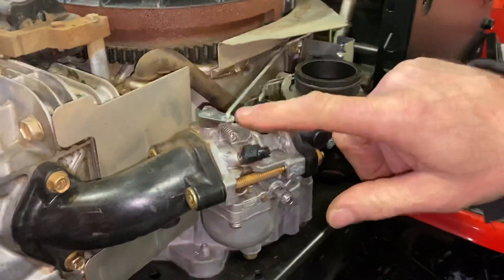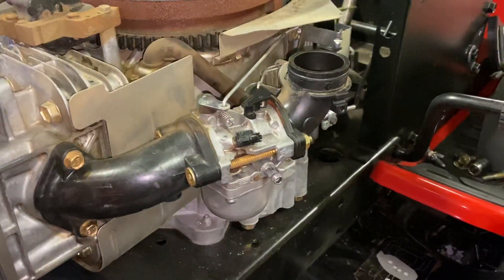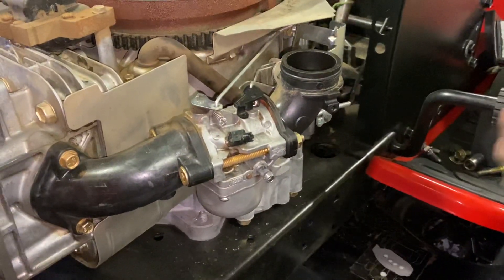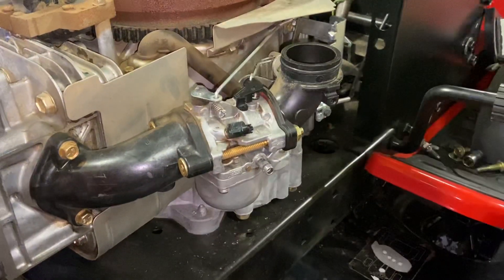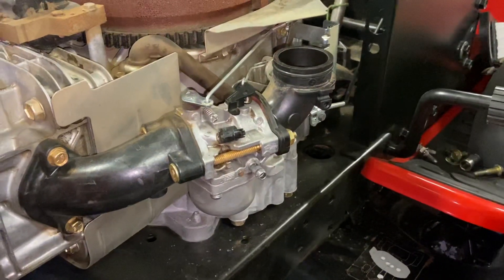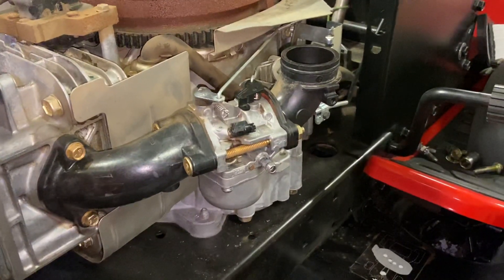Basically, this is the problem where these plastic rods actually just start to get a little bit of corrosion — they get a little fat. I don't know if it swells or not, but it definitely was sticking. So if you ever come across your tractor where you put it up on start in full choke position and it just stays choking, that is something to look for — your choke plate may be sticking in the on position. I'm not going to put the rest of it together; you can figure it out by rewinding the video. If you like the video please give me a thumbs up, and if you have any comments or questions you can reach me through YouTube or my website at johnsonsmallengines.com. Please subscribe, thanks for watching.